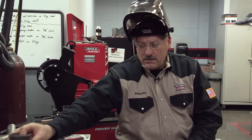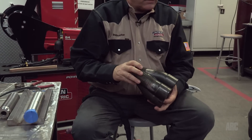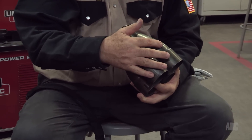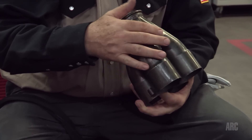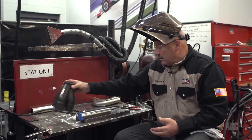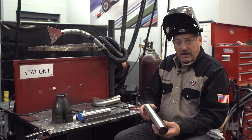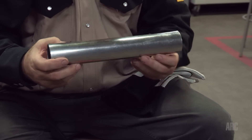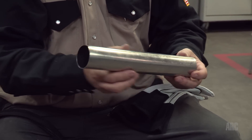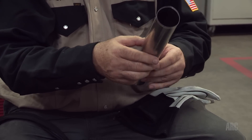I have a couple parts here. This is a used collector for probably an Indy racing team, and you can see that this part has been operated at high temperatures. It has a dark oxide coating on the surface — the oxide has been sanded off here. This probably operated at 1600–1800 degrees to get that oxide coating. When the Inconel is new, the tubes manufactured by the header manufacturers are made from sheet and often these parts are polished to a chrome-like finish. They're very expensive headers, so they're polished to a chrome-like finish.